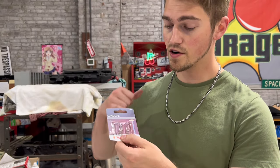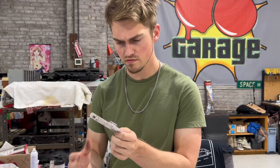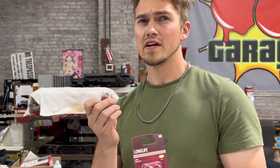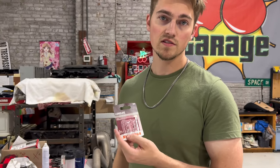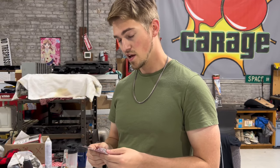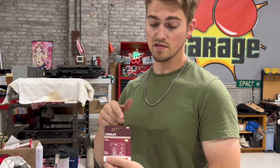These are the 168 bulb — you can also put a 194 bulb in there. The difference is the 168 runs at about 14 volts and 4.9 watts, while these originals are probably a 12 volt and 3 watt. More volts and more watts should mean a brighter light, so the 168 should give a brighter backlight. If you don't want it brighter, go ahead and get the 194 bulbs. You can get both the 168 and 194 in different color temperatures.